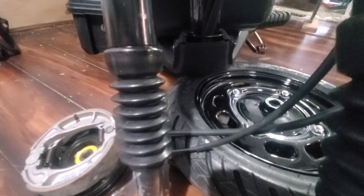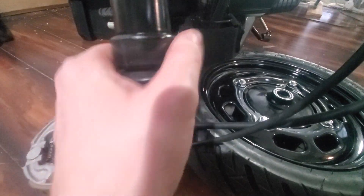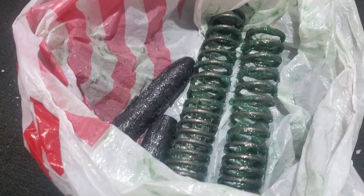With your wheel off, the fun part: you can take these dust shields down like that. Here inside the fork tube there is a snap ring — you can see the two holes for it right there. What you need to do is get your snap ring pliers into each of those holes, compress it, and pull it out.